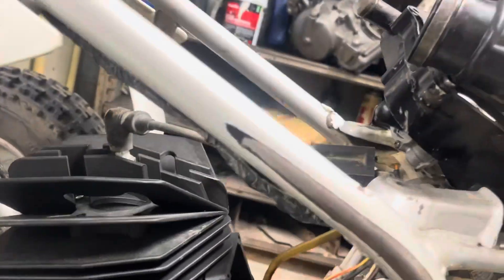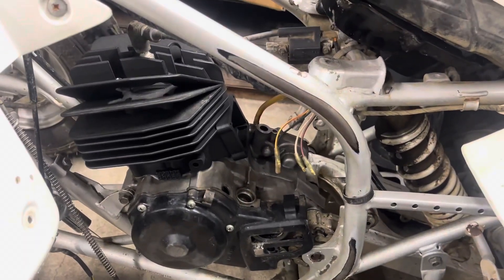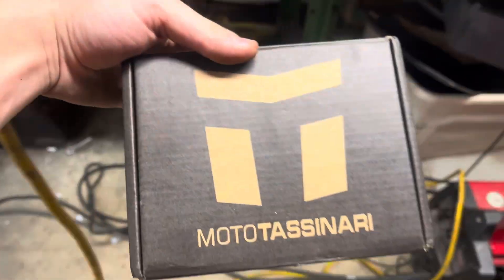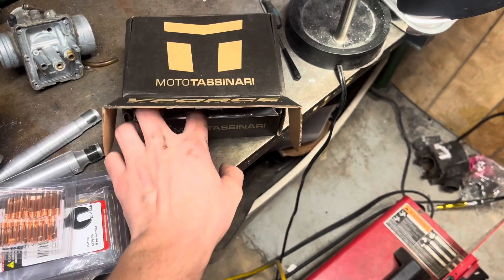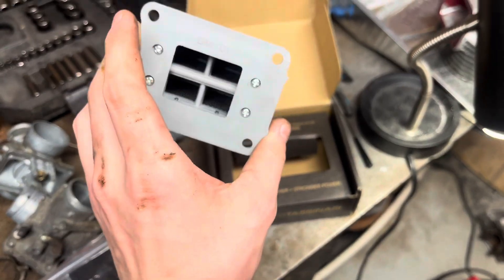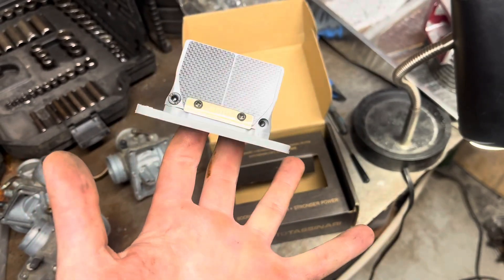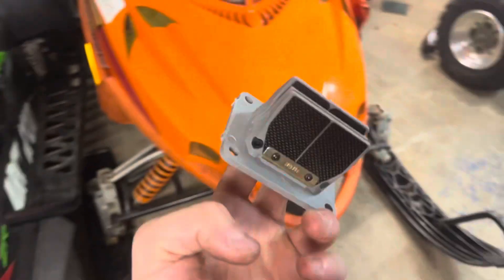I'm still going to mount the exhaust and the reeds. I have an air box from HPM Power Sports for a bigger carb. Right here I have a set of NSR-CR125 reeds — these are V4s, but they're not genuine. I wasn't going to pay for genuine ones — these are knockoffs that I've already modded to fit. What I'll do is junk these petals, buy some good reed material, and make my own to the V4's thickness. These are the reeds intended for use with my cylinder.